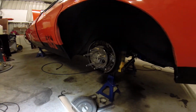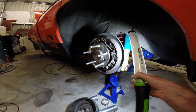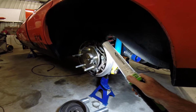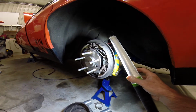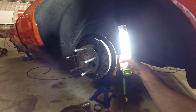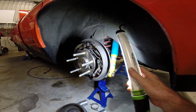I'll tell you a little story, guys. The guy that I'm going to mention actually told me about these little tricks. He runs an EH Holden, and he must be in the class that he's in, he can't modify his brakes because he runs drums all round on all 4 wheels. He was saying that he gets around 4 to 5 laps of awesome brakes, then you start to feel them go off a little bit. And what he's got is what they call water brakes. The supercars ran them. I'm not sure if they still run them, but this guy's got a little spray hooked up on each of the wheels. He's got a little nozzle poking in there, and he's got it on a switch. So when his brakes start to fade off a little bit, he hits a switch and it pumps a fine mist of spray on all 4 drums, and he reckons then the brakes are unbelievable for the rest of the race.